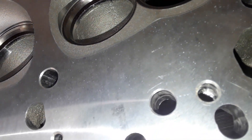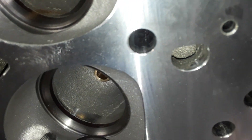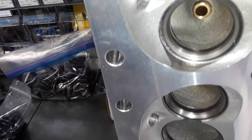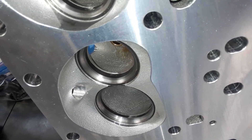What this will do over time is going to be interesting to see, but again it just shows you where quality control has gone as it relates to automotive engines in the aftermarket. It looks like teeny tiny little flakes of black pepper or tiny pieces of dirt, but it's porosity. There's no way to get rid of them — if you resurface the head, more will just pop up because it's cast right into the material.